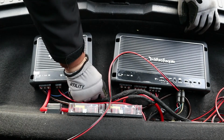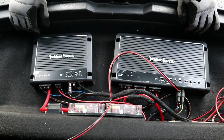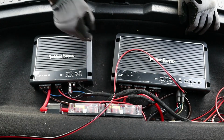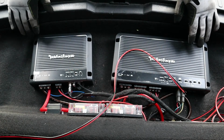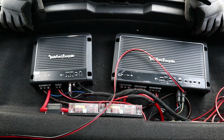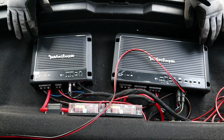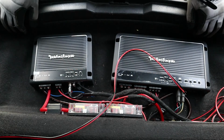I don't know if you're going to be able to see this, but there are little wire cuttings here. The reason why I did wire ferrules was to keep it neat, but also to prevent the little cuts of wire from coming out. Also, for tools, I would get wire strippers, not wire clippers. There's wire clippers and wire strippers. I say that because it'll be a nice, neat cut. It'll save you time and a headache. If you don't want to, you don't have to. Nobody's telling you that you have to, but that's just what I did.